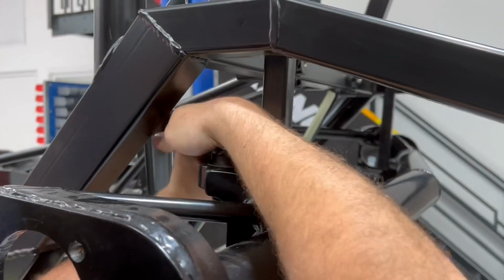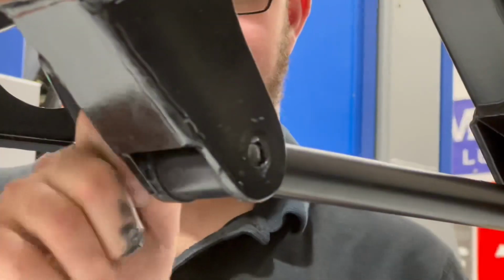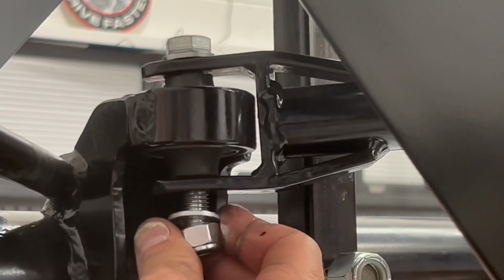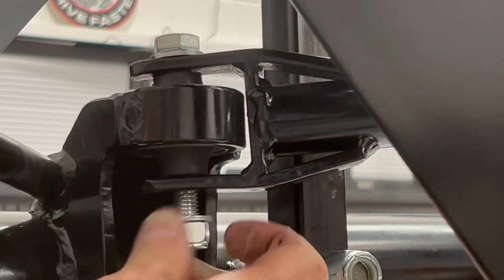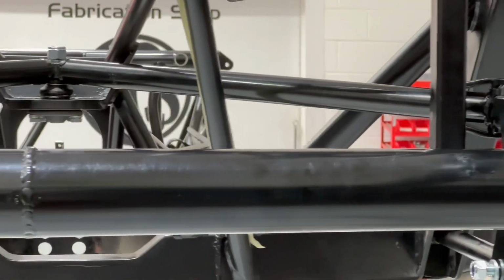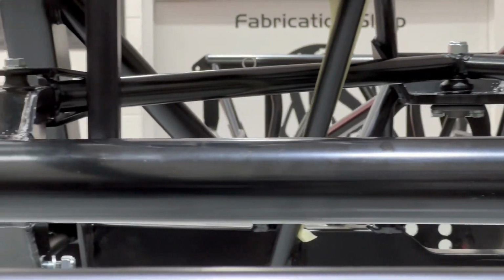Tighten up your shocks, bolt through in both cases, and finish putting the rest of your trailing arms in. Again, stress, don't forget your washers and nylocks. Easiest way to do it is to nip in the first instance and then tighten towards the end when you know everything is in the right place. You're now ready for the next stage.